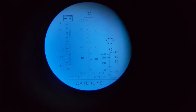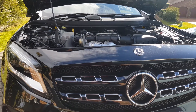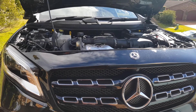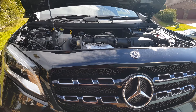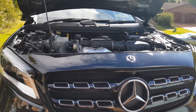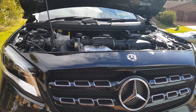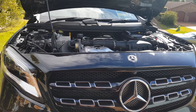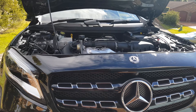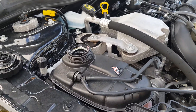Let's go ahead and take a sample of coolant out of this Mercedes and test it. The car is about 18 months old — you might say, why are you testing coolant on an 18-month-old car? The answer is simple: I've tested cars that are 18 months to two years old where the coolant level is incorrect and the cars aren't getting the correct level of protection. I've actually had to flush the coolant in those cases.